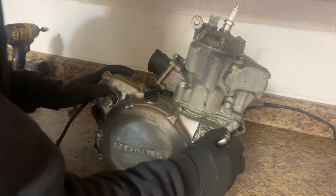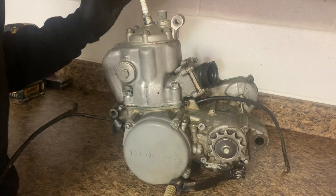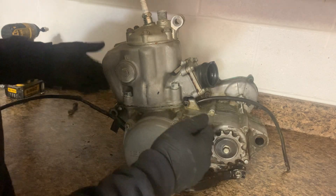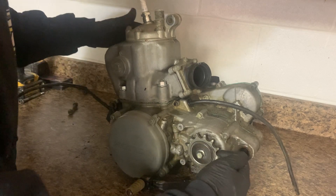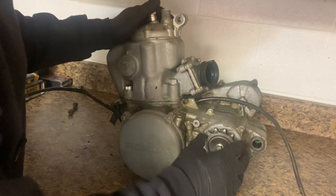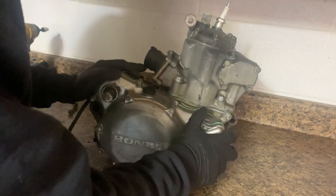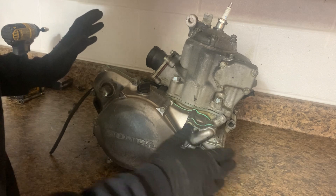You could vapor blast this motor assembled — I wouldn't recommend it, but I've done it. I've done my 450 motor and a bunch of other motors, which I took apart afterward without finding any media inside. The biggest thing is getting media inside — obviously you plug the intake and exhaust ports, and where the cooling goes it's very easy to put plugs. But with rubber seals like where the front sprocket shaft or shift shaft comes out, it could blow right past the rubber if you spray hard enough. I have ways to seal all that off and don't spray directly at those areas. I've done it maybe 12 times successfully — typically nothing bigger than a 450 motor.